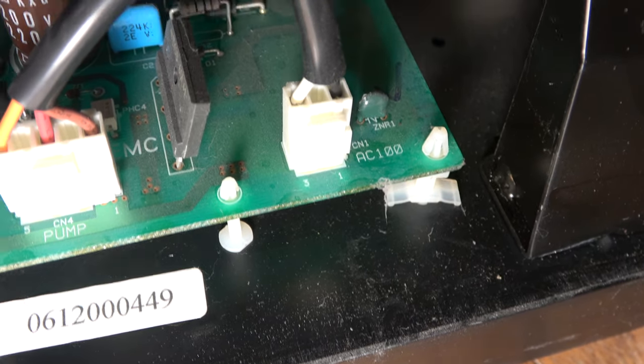You'd hope that they can't be plugged in the wrong sockets, wouldn't you? But those back two look identical. It's a bit scary. So the one with the black and white wires goes to the very back. That's a little bit scary. Right, we should have everything unplugged from the power supply. So I need to squeeze the plastic PCB standoffs, and hopefully that will allow us to release the PCB.